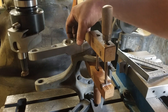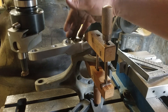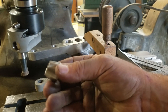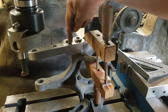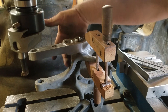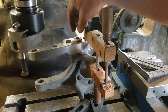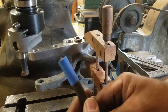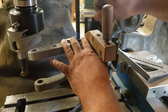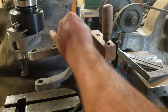So I've gone through and off-camera set this upper steering arm in a location that is very similar to the factory location. I'm going to take one of these wedge washers and place it into the hole. Now we're not using this hole — this would be for if I had an aftermarket steering knuckle that gives you a little bit of extra support right there. So I'm going to put the wedge in and then what I've done is I've taken my centering punch, put just a little bit of tape around it so that it has a snug fit. That way it'll give me a nice centering and then one good tap.